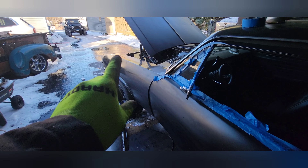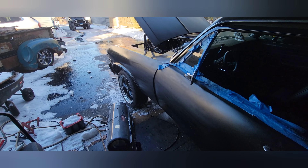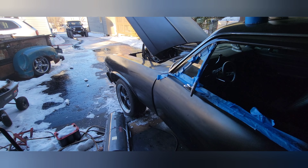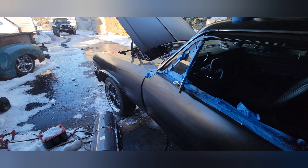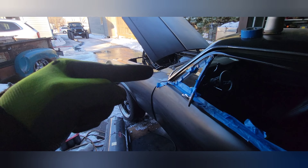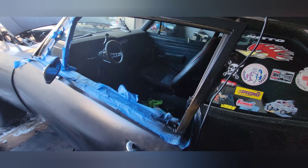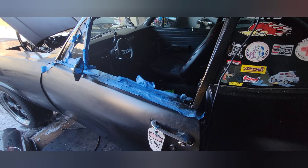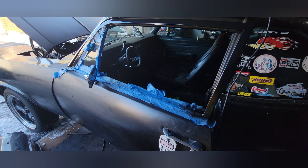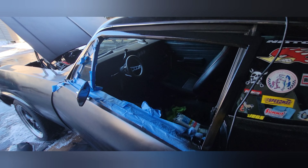The car is a tad bit shiny as you can see from the front fender because I polished it, but it's a flat black color. The slight fade is from spraying when it was really hot — it doesn't allow the paint to fully penetrate so it gives a dull look. It kind of looks a little rattle-can, so I want to move away from that. To save money I'm gonna transfer all this tape to the other side instead of wasting it, then finish the other side.